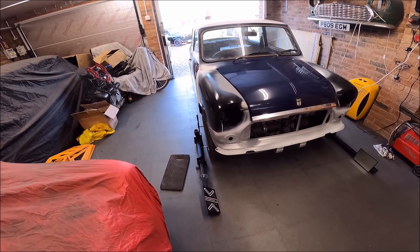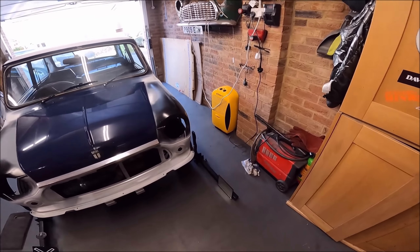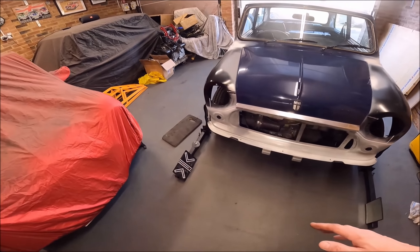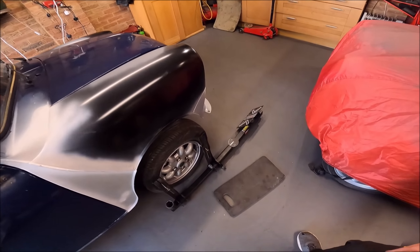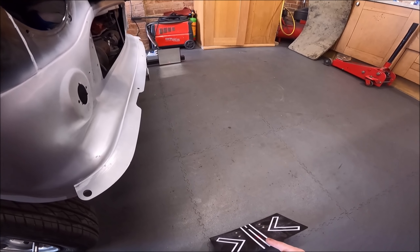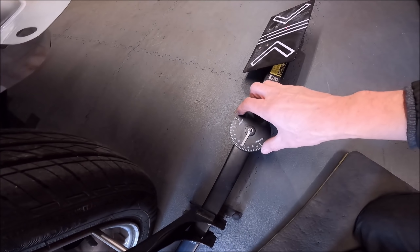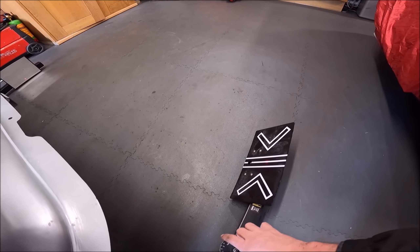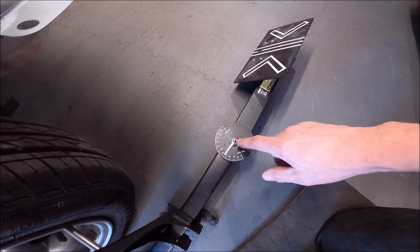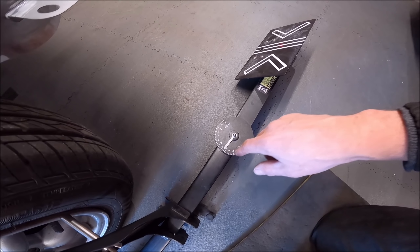If you go in and have a four-wheel laser align somewhere it's probably going to be a little bit more accurate than this, but these seem pretty good, to be fair — they're just a bit fiddly to get set up. They've got spirit levels on them; you have to get them set up perfectly and you need a nice flat, even floor. What it basically does is it has a small laser in one end, it shoots off, bounces back off the mirror, and then you adjust a dial to get the dot in the middle. Once the dot's in the middle, you can read what the tracking is set at — this is in degrees and minutes. So that is about less than one degree toe out; it's about 45 minutes toe out.